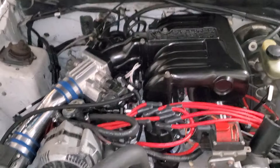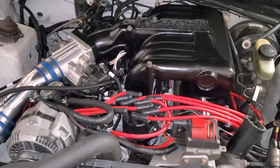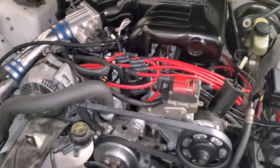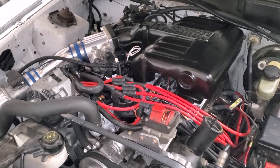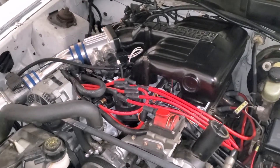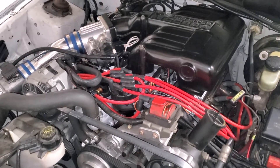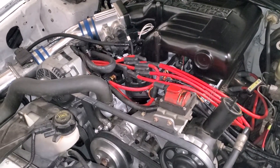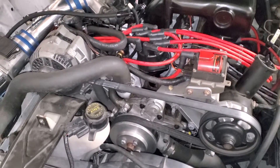It's been a couple of days. I've narrowed it down — it's basically temperature detonation. At operating temp it detonates under full throttle in first and second gear. In third, fourth, and fifth gear it doesn't do it. In first gear it's almost like it's hitting the rev limiter around 4,000 RPM, and in second gear it's just classic detonation sound. I verified the timing just like in the instructions for the dual sync — it was dead on, I didn't even have to change any delay time.